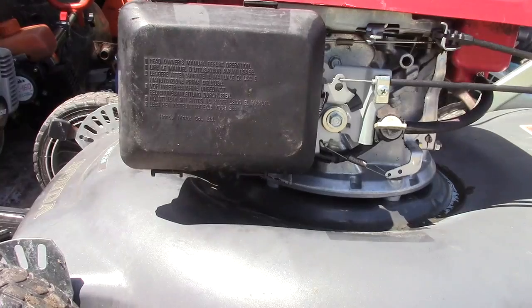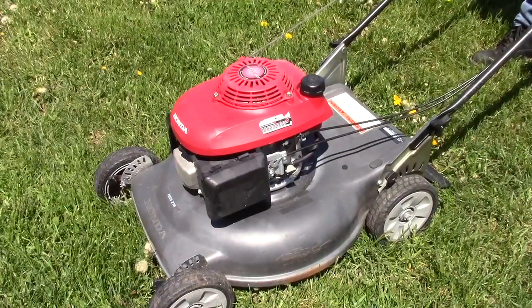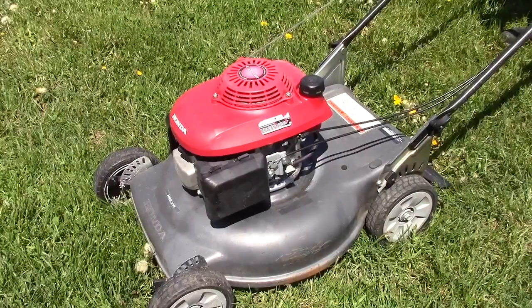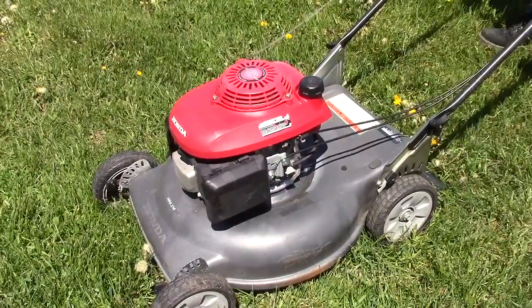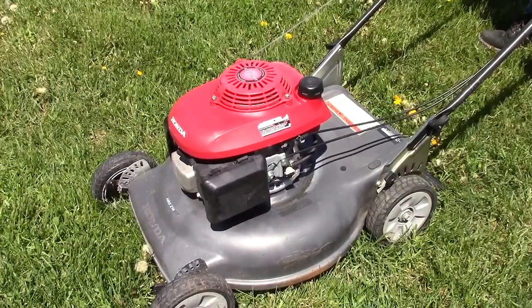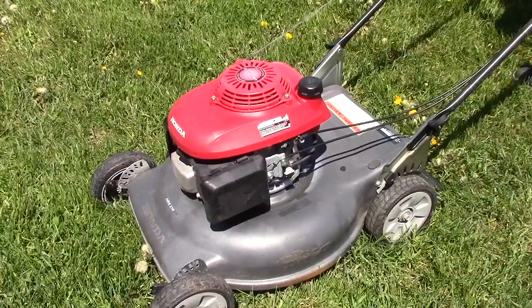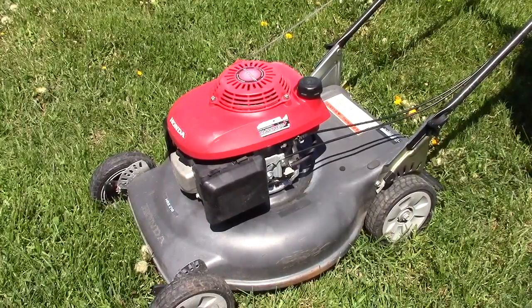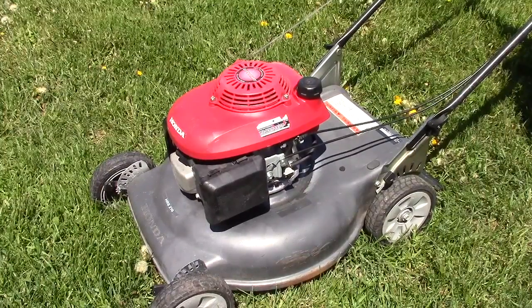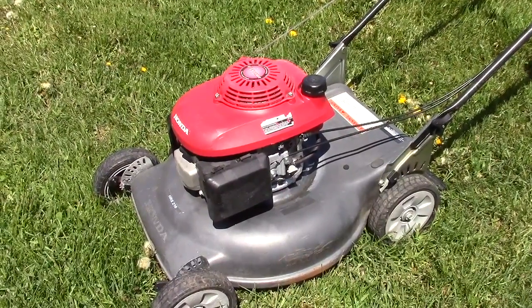We can now install our air filter and the air filter cover, and our fuel is turned on. We'll get this lawnmower off the back of the truck, put it on the ground, and see if she starts. I did have to do a slight adjustment on the choke cable as it wasn't operating all the way to fully close the choke. We'll give it a pull and see what happens. It runs pretty good — it does have a throttle adjustment so I had to put it on low throttle. It's back up and running again. That's all it takes to get your Honda HR-S216 back up and running again. Thanks for watching — hope you enjoyed this video. See ya.